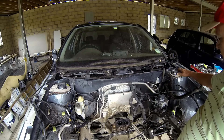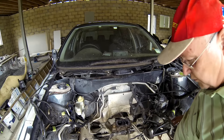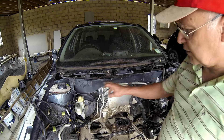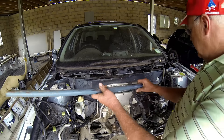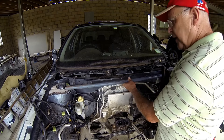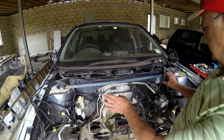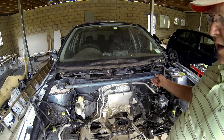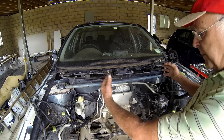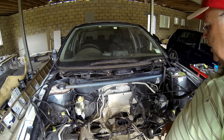And when they're in place, you'll hardly even notice it. I like to try and get a factory look to what I do. Rather than putting the bar across here as a bolt-on, I'm just going to weld it in place because we're unlikely to need to put it on another car, and we don't need to take the bar out to get the engine out because the strut towers are so far back in this car. That will make the strut towers really firm and stop them flexing and make the suspension work a whole lot better.